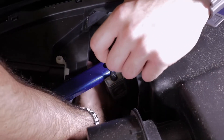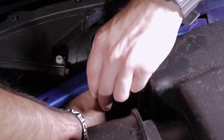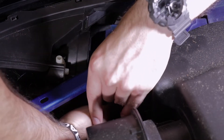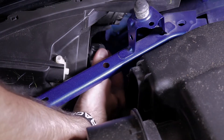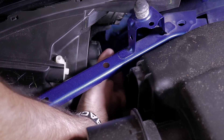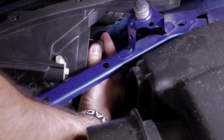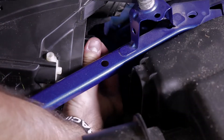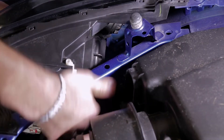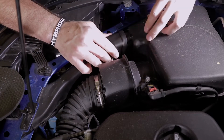When you go to install this on the passenger side, you want to tuck the driver inside the headlight housing before you try to secure the bulb — that'll make securing the bulb much easier. Also note that when inserting the bulb into the housing, you'll notice it bumps up against a couple of screws inside the housing. That's okay; it just takes a little bit of extra force to get the SL1 to sit properly. With the SL1 properly seated, reinstall the factory dust cap and then reinstall the plastic intake tube that we removed earlier.